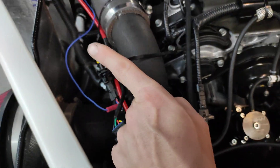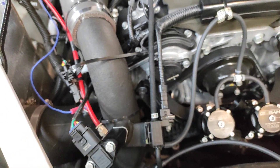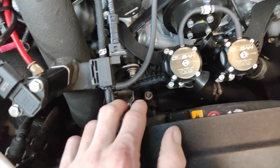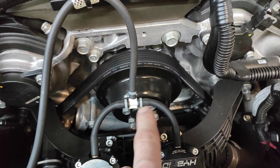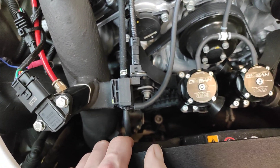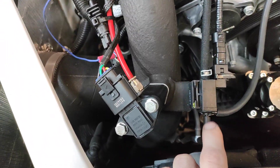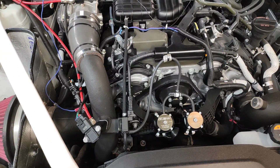Now take this hose and run it in the desired direction. There is a debate about whether or not you need a clamp on these barbed fittings — it certainly couldn't hurt. Mine were a little loose, so I used small zip ties, which works fine. Most of the time these don't come off because there's not a lot of PSI on these small lines — the cumulative pressure isn't great. But it will cause a boost leak if one falls off, so securing them is worthwhile. That sums up how to hook up the boost line for a mechanical boost gauge.